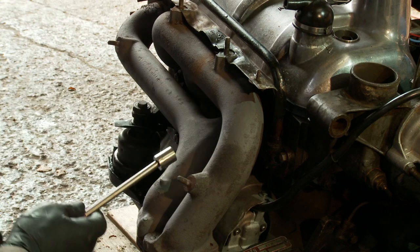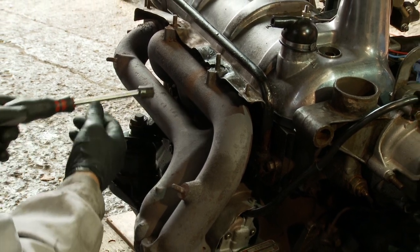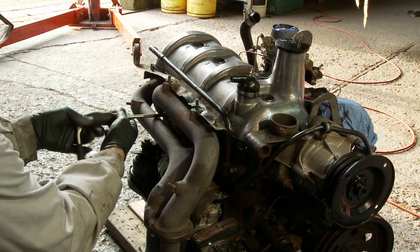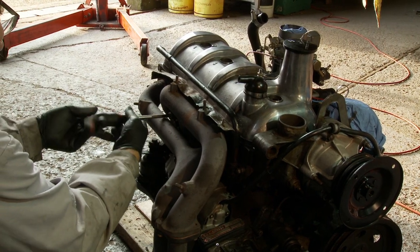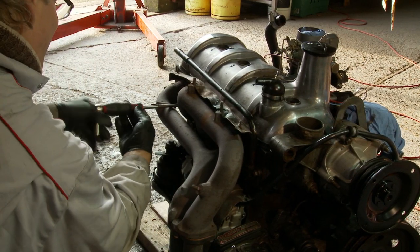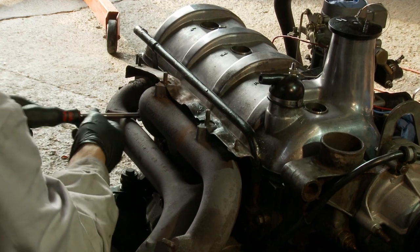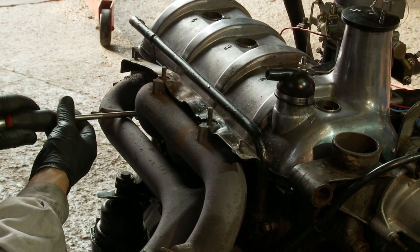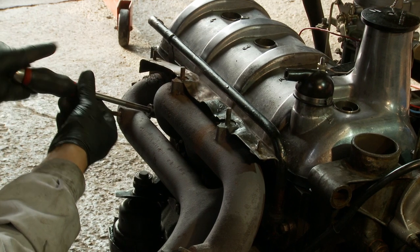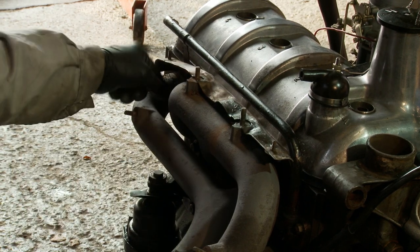It is the nut — it's half come undone and half come off. Typical. These might well be stainless steel nuts. The problem here is that as the stud comes out, it traps the socket. You can grind the socket to suit to give you an extra bit of clearance. This is slightly typical in that the nut comes out halfway and then the stud comes out halfway.